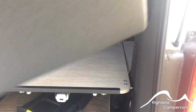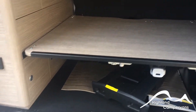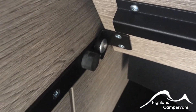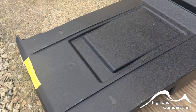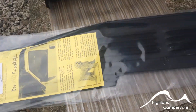The rear cushion and the parcel shelf below can be removed and stored in the garage. To remove the rear parcel shelf, undo the two clips on either side which allows it to rise up. This will also expose the location of the table for the lounge area — the table simply slides off the two catches located here and here. Stored in the rear of the vehicle you will find your toolbox and a complementary set of dog-friendly air vents to go into the two front windows.